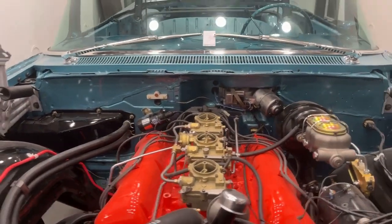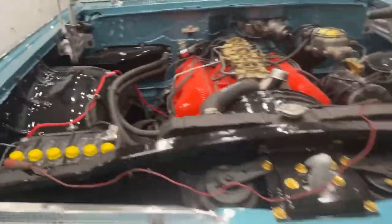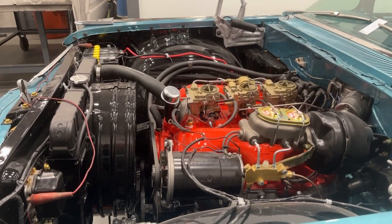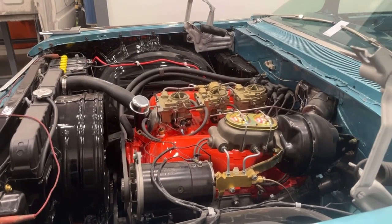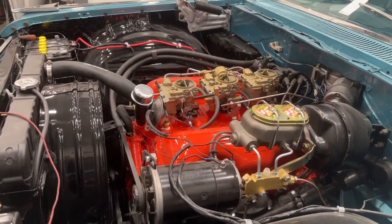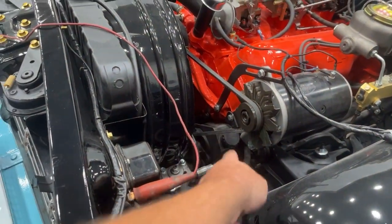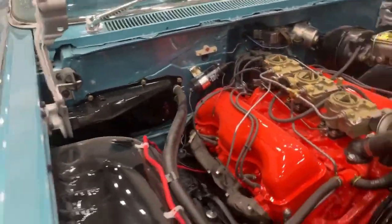I think I'm mostly done with the wiring. I don't have the turn signals in or anything, and the backs aren't in yet. There's no fuel yet, so what we'll probably do is pull the distributor, spin the oil pump — it's been primed already but we might spin it again — then crank it without fuel first, then add some fuel and see if we can get the fire off. I've got to put coolant in it still, and it needs power steering fluid. I've got to make sure I put power steering fluid in before I even start it, because those pumps will blow out — I've had one go low before, and by the time I turned it off and filled it up, it had shot the pump.